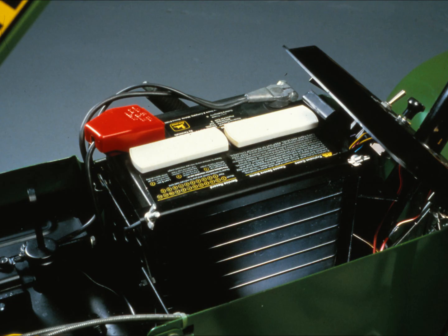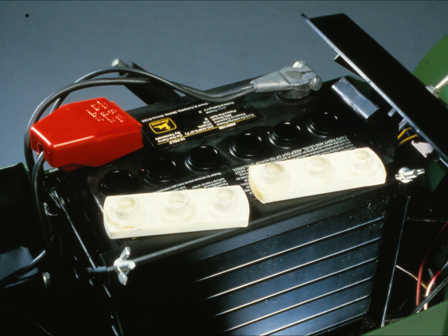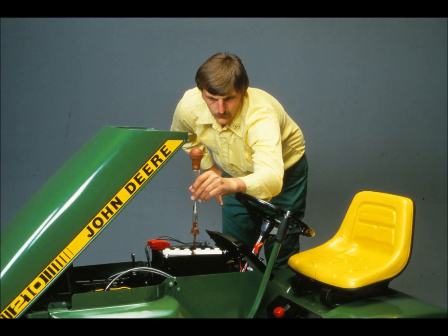Look for dirt on the battery — excessive dirt can cause the battery to discharge itself. Clean the case and look for cracks, breaks, or damage to the terminals. Check the electrolyte; in extremely cold weather the battery could be frozen. Do not charge a frozen battery — it could explode. If the electrolyte is low, add distilled water; never add electrolyte to the battery as a dangerous chemical reaction could occur. Check your technical manual for details on how to use the hydrometer to perform a specific gravity test. Specific gravity indicates how well the battery is charged; there should be no more than 50 points variation between the battery cells.